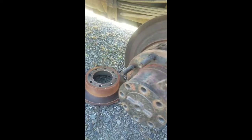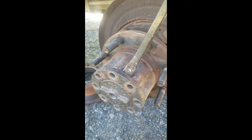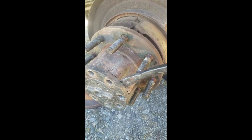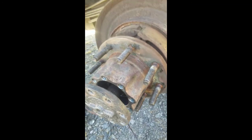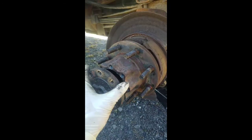So we're back after removing the bolts. We're going to remove this piece — this one was a little seized. Like I said, you don't need a puller; you may need to pry it out just a little bit. I'm just going to bump it a little bit. You can see it's starting to break loose — just be gentle. Kind of put my pry bar against the lugs. There we go. You can see the fluid pouring out now, so I'm going to jack it up a little bit more to stop that stream and make it more difficult for it to run uphill and lose all the fluid. The axle came out of the spline at the diff, so just pull it out gently.